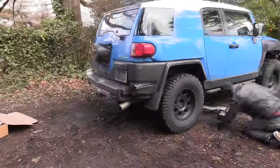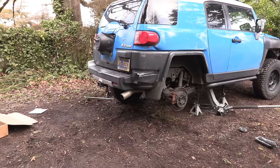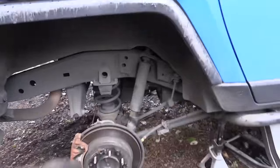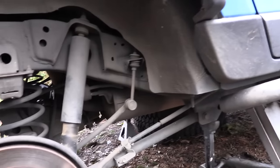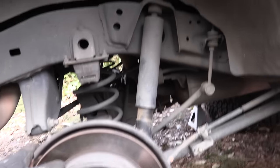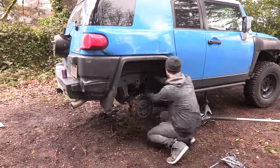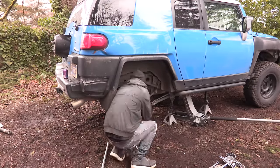The back is all lifted up and the weather has started. I'm struggling with the height of these jacks and jack stands with an SUV — you might want really tall SUV jacks. To remove the rear shock, there's a bolt up top and a bolt in the back. Those two need to come out and hopefully the shock will come out without too much trouble.